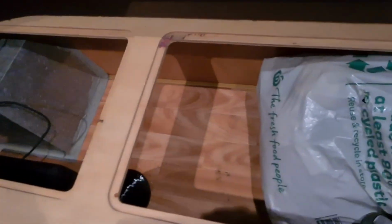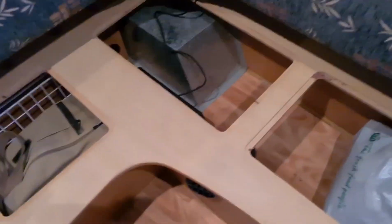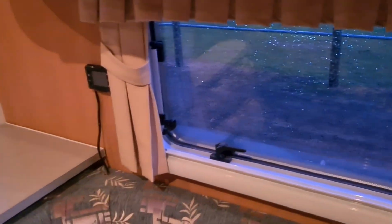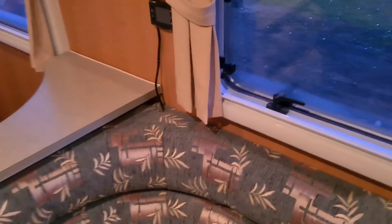So we've just put that outlet hose on, obviously the outlet side, and that just comes through here. It's going to intake most of its air from back there and push it out here, which will recirculate that warm air in the van, which will heat it up a lot quicker. And as we said before, we've done our unit inside, and I'll take you underneath and show you what we need to do down there.